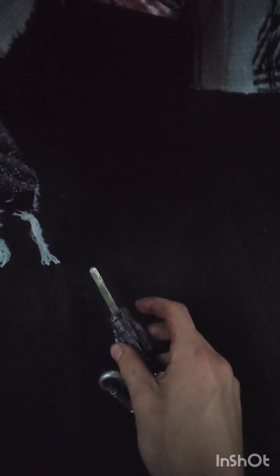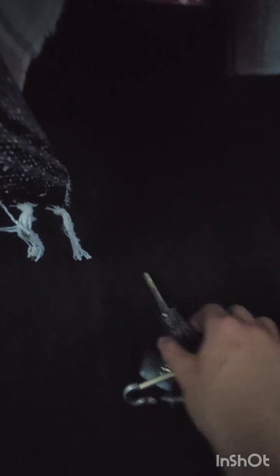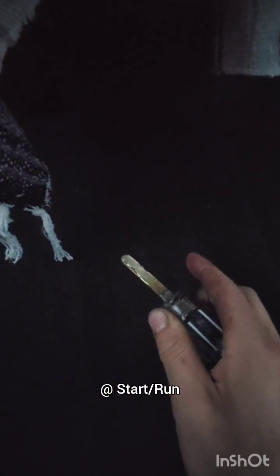If you're trying to go with a screwdriver key, you just stick your transponder in areas and test where it will sit. Sometimes, like that one guy I mentioned, his would only stay within three and nine o'clock specifically. Anywhere else it would not go through, because that's normally where this side of the key would be on the outside of the antenna. Mine's not like that — I could stick it anywhere and it'd be fine. But that's stuff you need to test before you get it fully epoxied in.